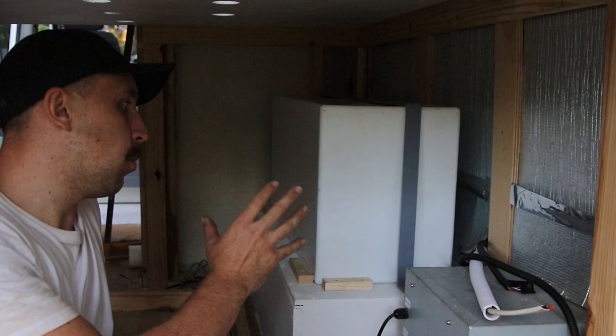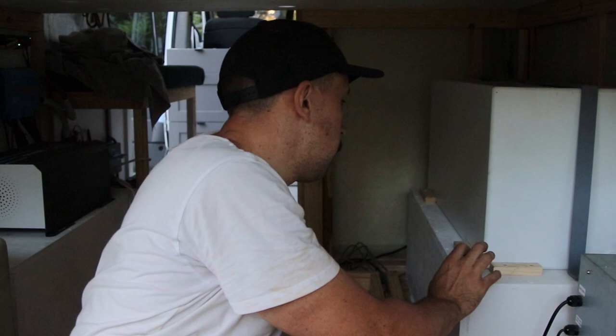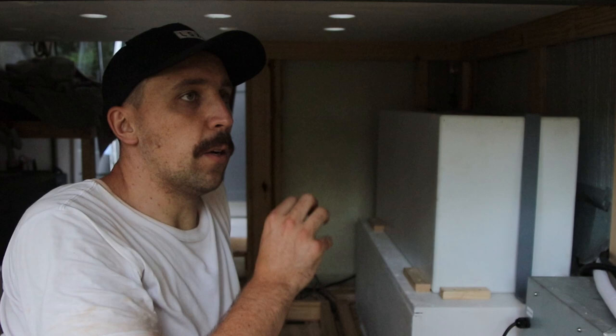This is the auxiliary tank. It's sitting on a reinforced box, secured in place with some little braces, and I welded up a brace that I'll give another coat of paint and screw in just to keep it in place. The purpose of this tank is to supplement the other two tanks — this one equals the two fresh water tanks underneath. When we drain those we'll have the option to turn a tap here and fill those two tanks down there.